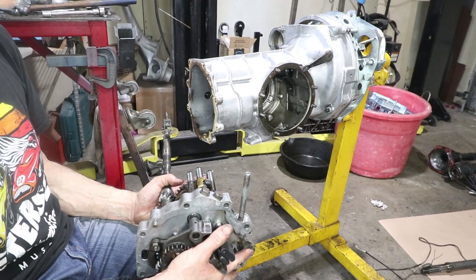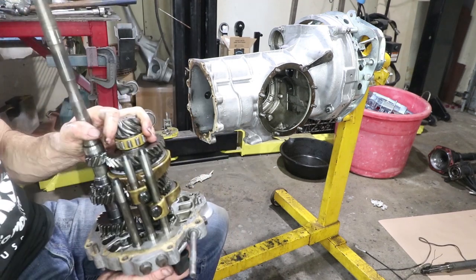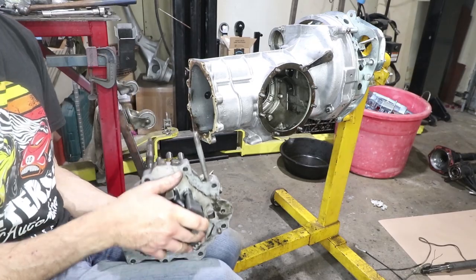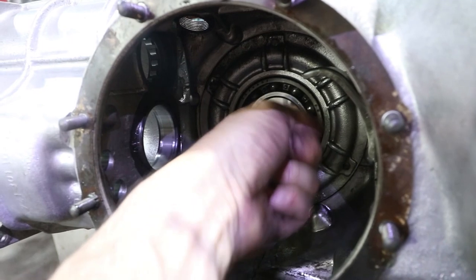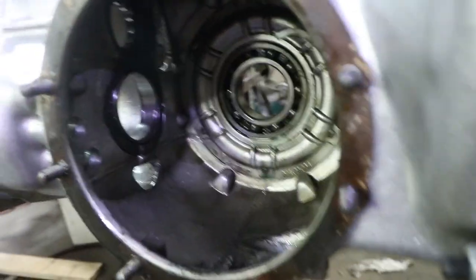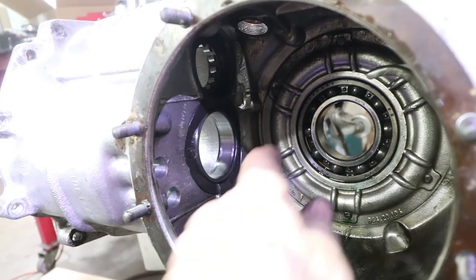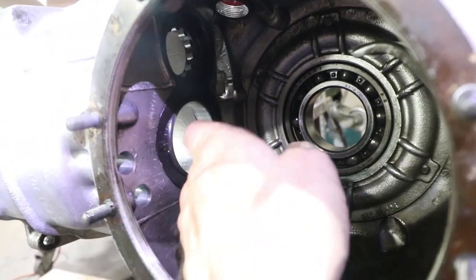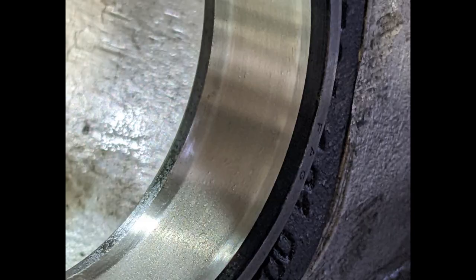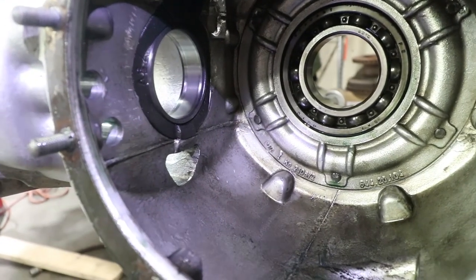We might as well take the whole cluster out too — can of worms everywhere. That's the whole transmission right there — super simple. Right away, just looking at the pinion gear, there's no pitting, no gouging, nothing you can feel with a fingernail — that feels fantastic. The bearing is good, the gears look good. I can see some wear in the dog teeth — you have to really zoom in to see those — but each gear looks good: nothing torn, missing, broken, or chipped. We're in pretty good shape, a little better than I expected. We also have to be very careful about this gasket — it separated when I pulled it apart, so we'll have to replicate that distance because it affects how far the pinion goes into the housing and affects the gear mesh. That's really why I measured the backlash before. This bearing on the other cover feels really nice and smooth.